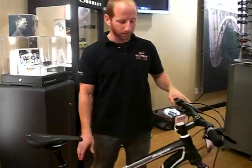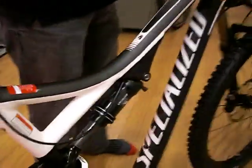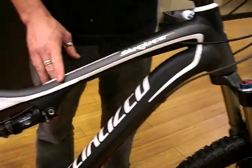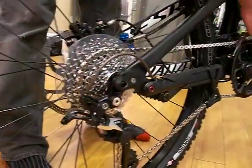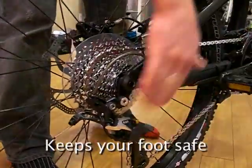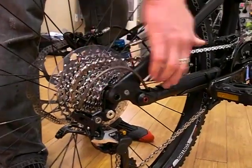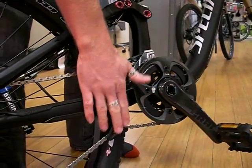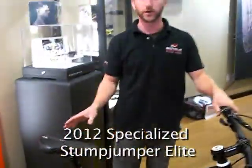It's a super durable aluminum frame — it's all hydroformed. It's got internal routing for the cable for the seat dropper post that goes through the inside of the frame so you don't catch your knee on it when you're pedaling. The rear derailleur is tucked behind the chainstay so you don't get that slap that may hit your heel as you're pedaling. Everything's tucked right inside so you don't catch the cable on anything, right through the bottom of the chainstay. This guide keeps the chain and everything else in place along with the tension from the derailleur.